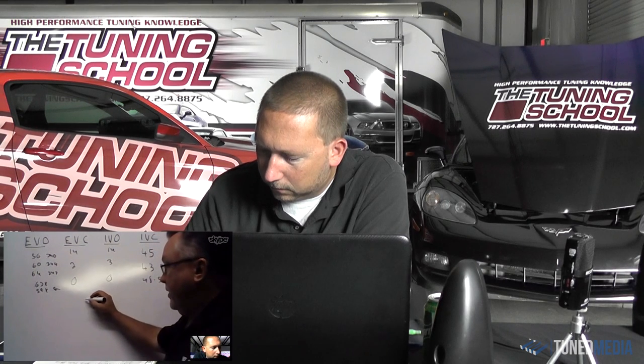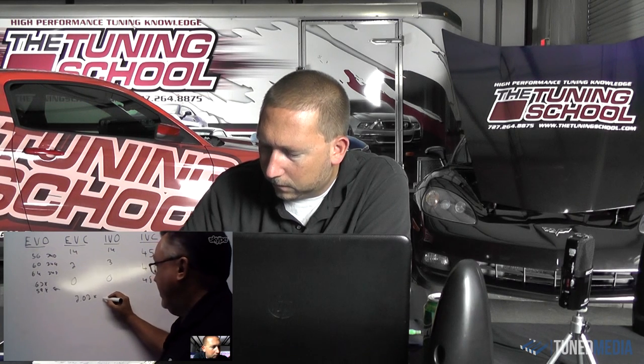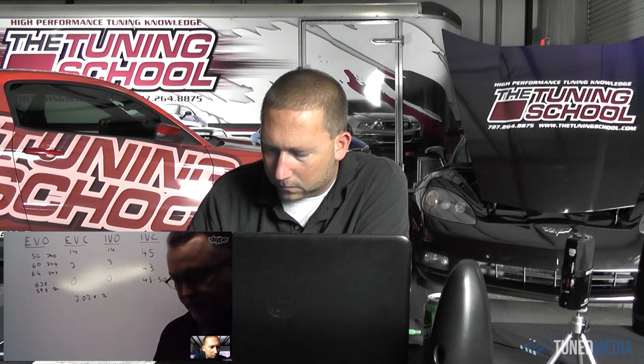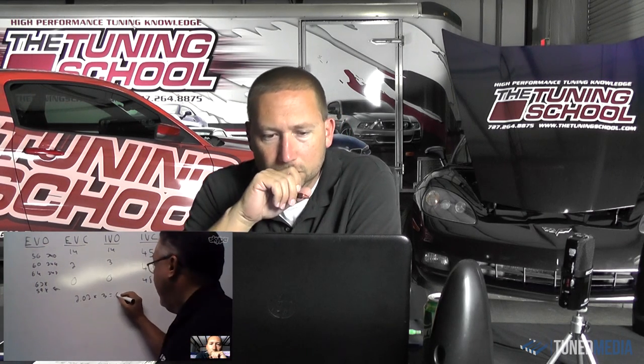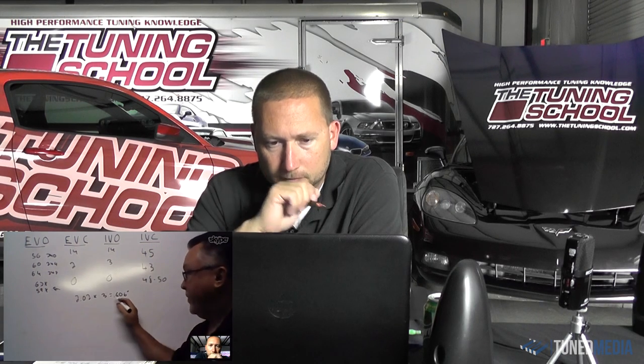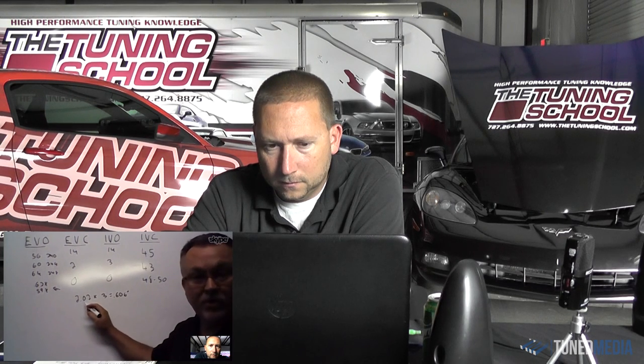I would like to talk about valve diameter to lift ratio. Let's say you've got a 2.02 intake valve, and let's say we think this 0.3 valve diameter to lift ratio is a good point. So 2.02 times 0.3, we're at 606 lift. Well, what we found in testing is that this 0.3 valve diameter to lift ratio is kind of the point of diminishing returns, quite honestly.